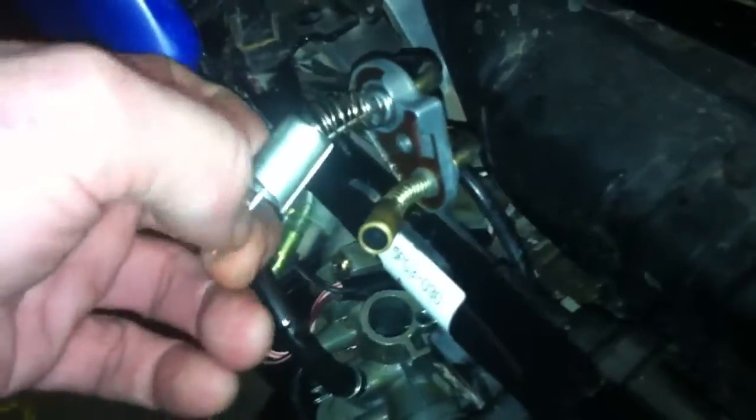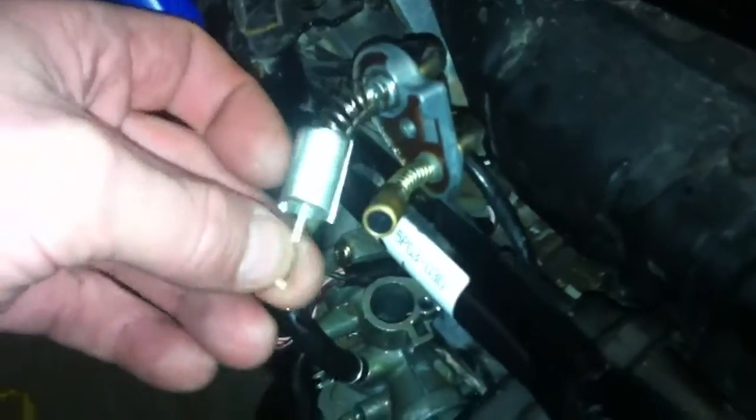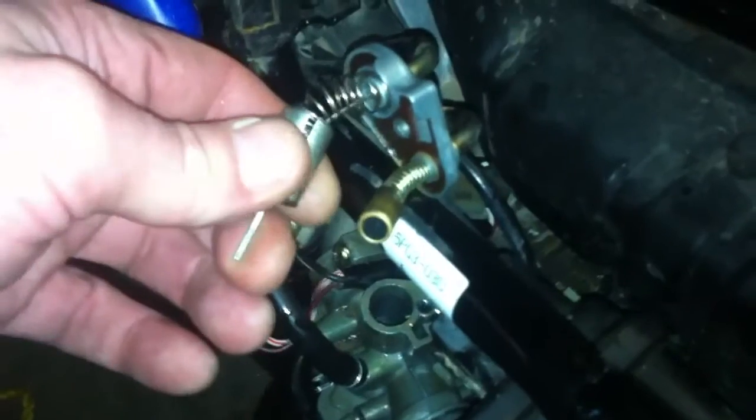This slider is rough, so it's probably not sliding down into the carb properly — it's sticking and allowing it to over-fuel as it goes down into the jet and probably not seating itself properly. The gasket on the top of the carb looks fine. I did drop the screw for the carb top down in the bike somewhere, but it's not in the carb — we'll find it.